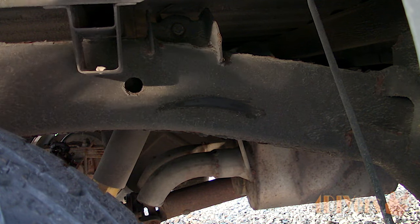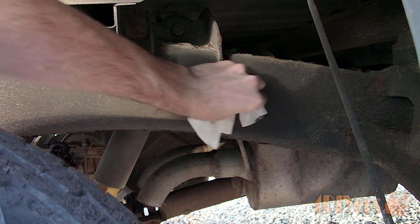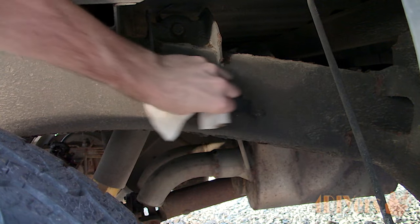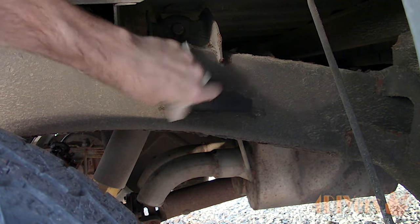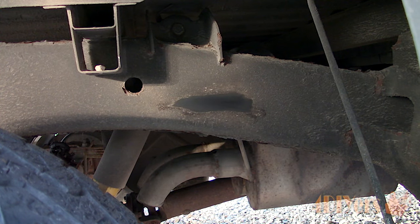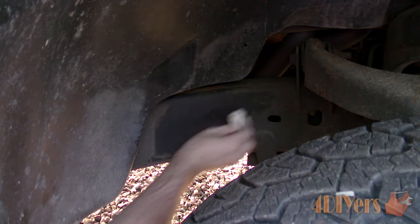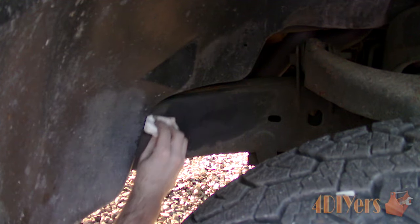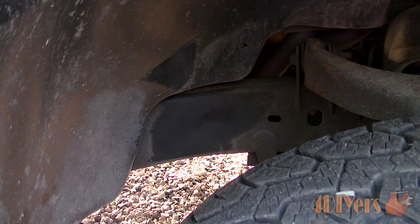The frame has had an oil spray applied at some point in its life as shown by the build up. A plastic scraper can be used to expose the paint behind it if you wish, or you can sometimes remove it with your finger. This exposes the base and it's sometimes good to see what's hiding behind it. A factory painted frame will have a smooth clean finish. If you are noticing paint over what appears to be pitting metal, someone has painted over what was a rusty frame. Painting is fine as long as someone did a good job. With the small amount of rust on this frame I'll probably go around with a wire wheel to spot clean and paint those areas to prevent it from getting worse.